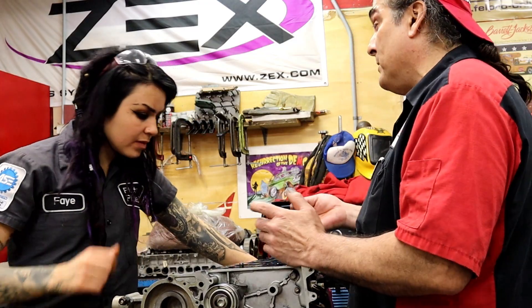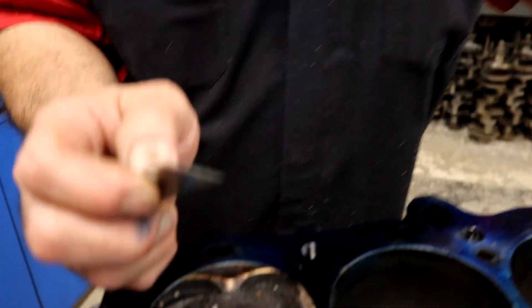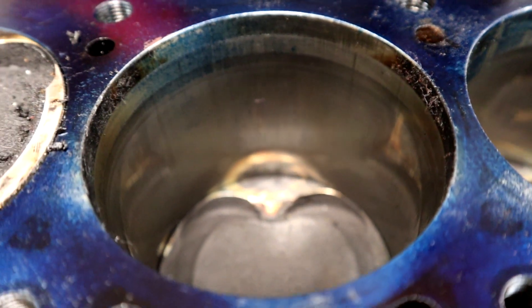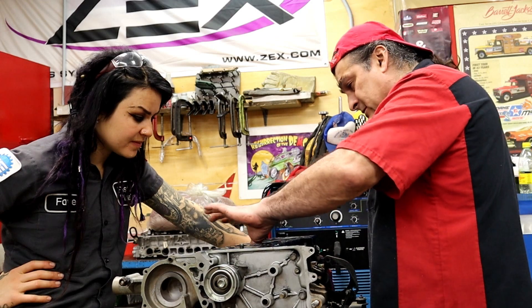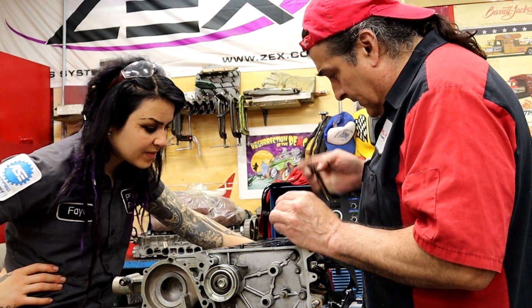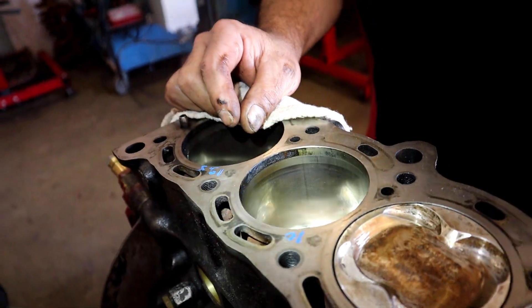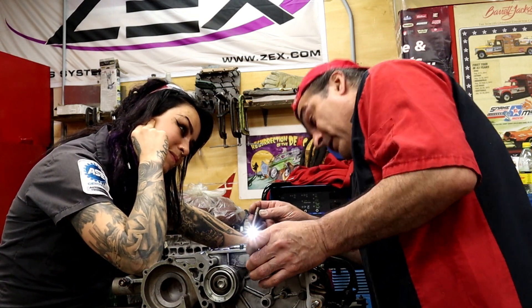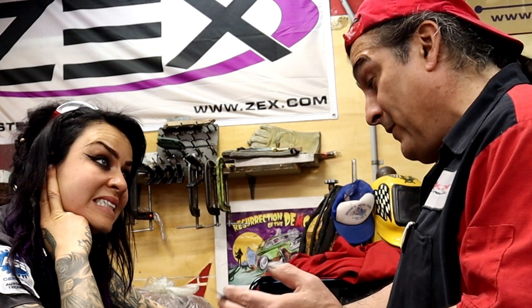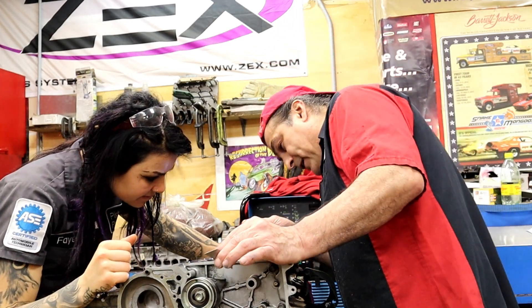That was going to be what's called a carbon knock — you were going to start knocking before long with this carbon. And that's why these are clean — you already had a little carbon knock going on because the carbon was hitting the head. I can still see the cylinder crosshatch. When you can see the crosshatch, the real deep scratches means it was slightly a little bit rougher than it probably needed to be, but they were probably doing a little bit rougher finish. They're not going to do a real fine plateau hone because if you don't know how to break it in, you're going to glaze the cylinder and it's going to be smoking. So I don't think it was a ring problem at all — the cylinders look really nice.